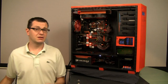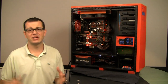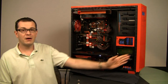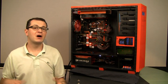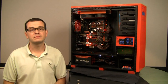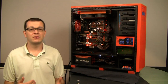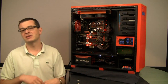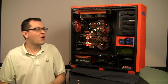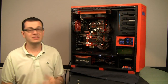The biggest mistake I made in this build was not checking how UV orange coolant would actually look under UV light. I was just assuming that if it's orange, it would glow orange — but it doesn't. It glows a greenish-yellowish color. So a lot of the work I put in with UV lights didn't work out. When making selections for colored liquids, cables, or anything else, make sure you verify what color it appears under UV light versus normal light, because it can be quite different — like orange under normal light and yellowish-green under UV.